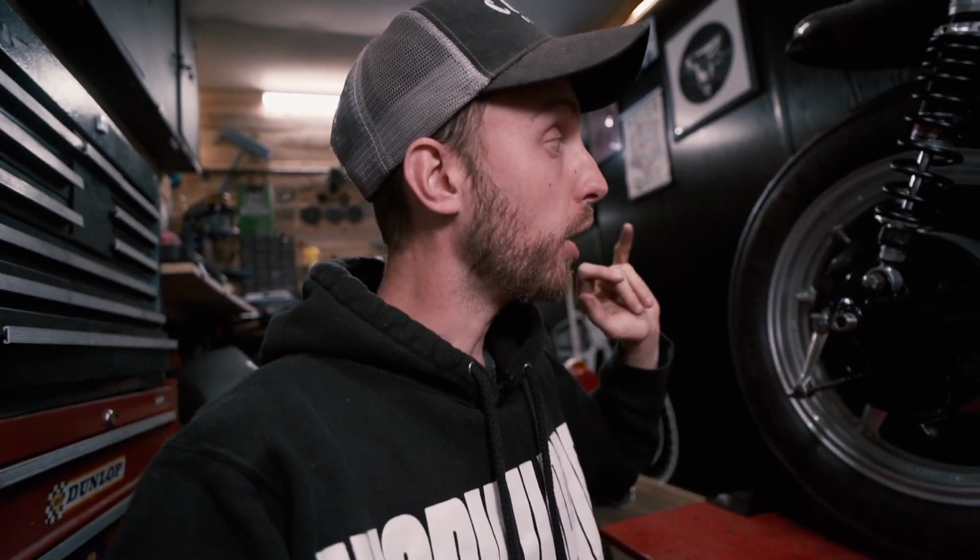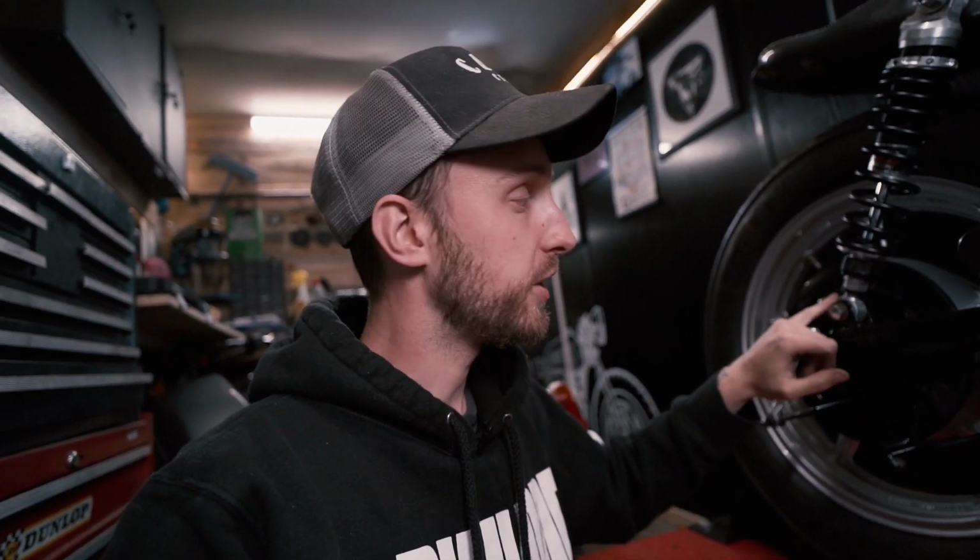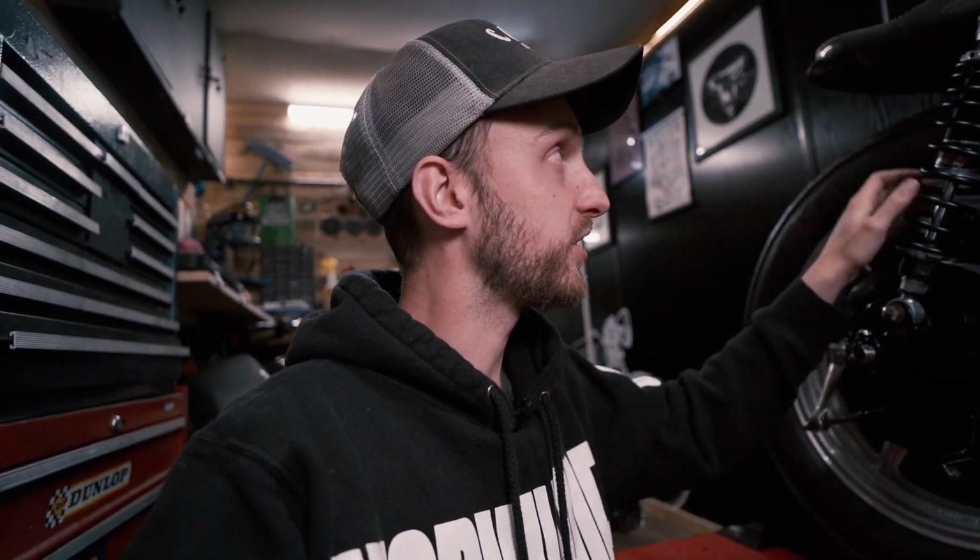So the standard shock lengths for these bikes are 320 millimeters in length. These ones here are 330, but they also have the additional 15 millimeters of adjustment on the bottom. So I do have a little bit of room to fine tune the adjustment and setup, just in case it does rub at the top. I believe these are off a Yamaha VMAX. I can't remember the exact model, but I'll put a link in the description to the ones I bought, just in case you want a little bit extra length for your XJ650. But yeah, these are a really nice looking shock, and I've heard loads of good things about YSS shocks, so hence why I bought them.